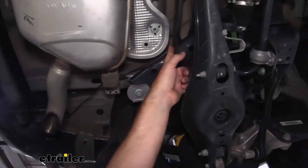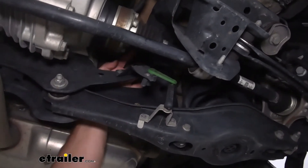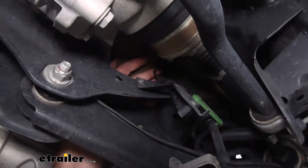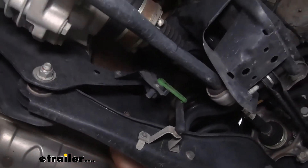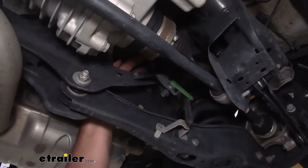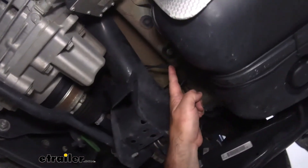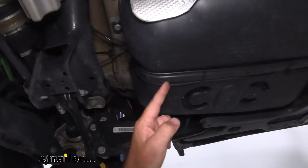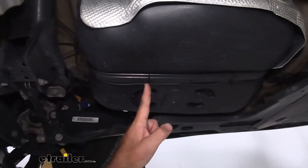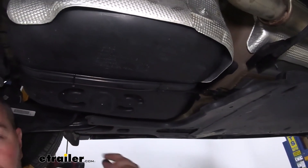Going over the top, right up here there's a wire. That center wire right there — you want to make sure you go underneath of it, because if you go over the top the wire will actually pull all the way over and sit inside your spring. That wire attached on top of the bracket will keep our wire from pulling all the way over. Straight over to the bracket that's holding our fuel tank up — I just tied the wire up here at the top, here at the bottom, and here. That keeps the wire up tight against the vehicle so it's not hanging down, potentially getting caught on anything that may be kicked up by the tires.